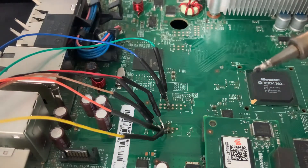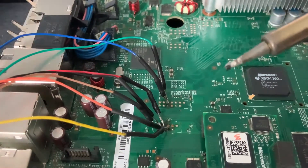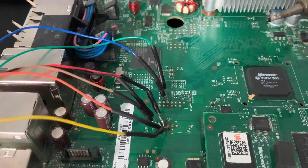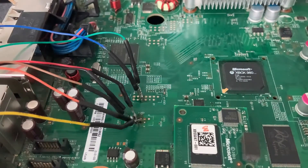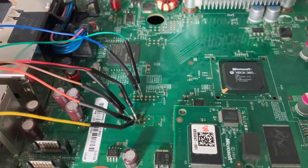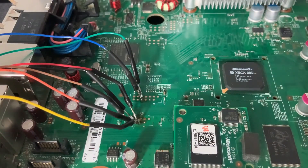I'll pop the wiring diagram picture at the beginning of the video and a link to it in the description, so you have something to refer to if the video is a little complicated. Installing the chip itself is also pretty straightforward. I can't do one right now — this is another dead board I'm using as a donation for these videos. I should have some Elites coming in so I can do some Cool Runner and Matrix installs. It's fairly much the same; it's just the way the wires are routed. Get those installed, plug it into J-Runner as you would with your NAND-X or JR Programmer, and you're ready to go.